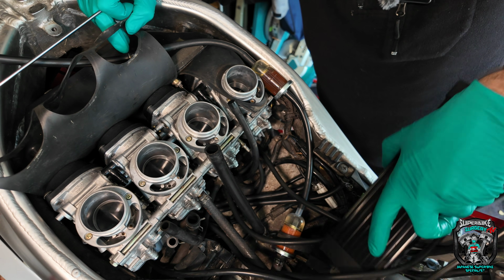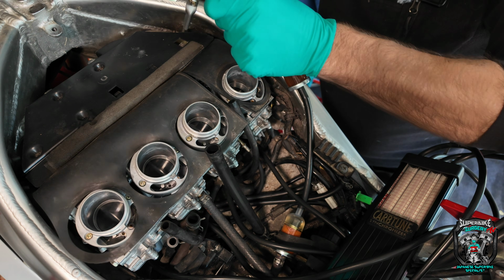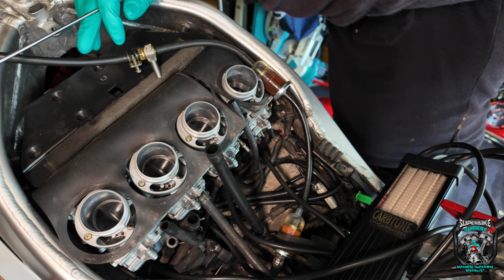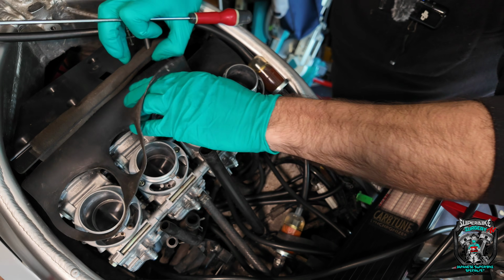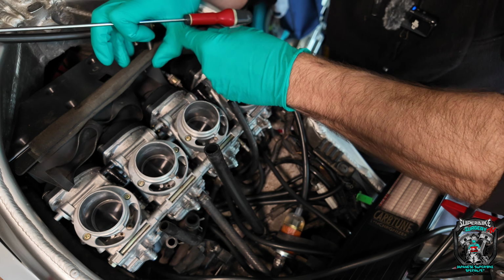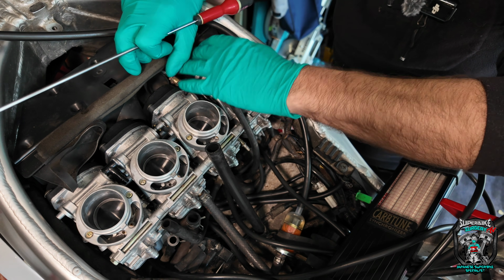I've got a new, can you see that in this shot? I've got a new fuel filter. I've got a fuel supply hooked up to it. I've just primed the pump and it's filled the carbs up. Let's in fact tuck that up under there out the way just for a second. Coils are on. See if it'll go. No reason why it won't.